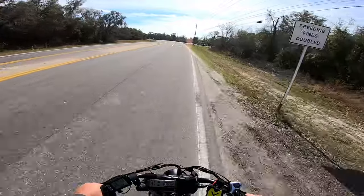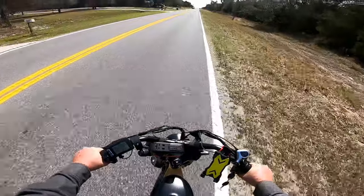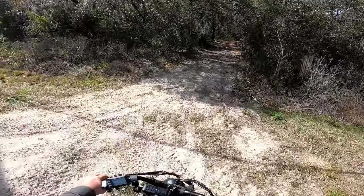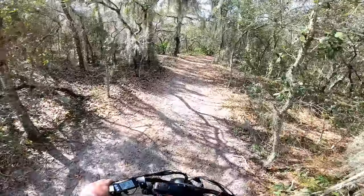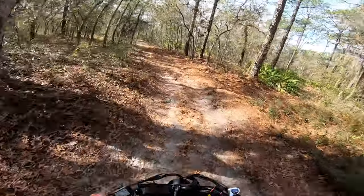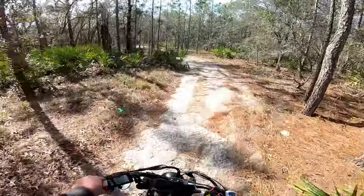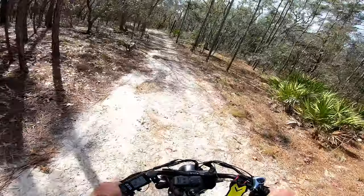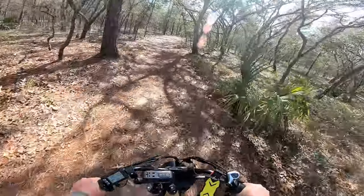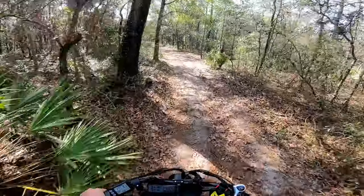I know a little trail shortcut up here — we'll take that. See how it does off-road. There's the 10-mile mark — still shows all five bars. Now if I was trail riding more I would let a little air out of the tires, put about 15 PSI. Things are pretty good in the sand though, even with the high-pressure tires. Lower pressure is better in the sand. Just that one clunk out of the forks on the rebound on that one bump.